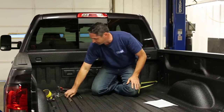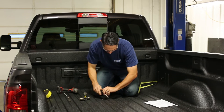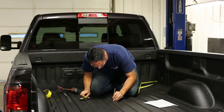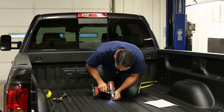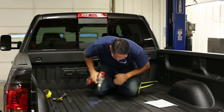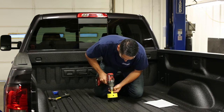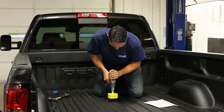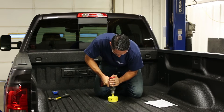Now we can punch our mark with a center punch — make sure you wear your safety glasses. If you can keep this as precise as possible, your hole will be nice and perfect in the middle. Now we can drill our pilot holes. We're going to cut our four-inch hole in the bed — take the time to allow your saw to do the work, don't force it. If you're using a drill like this one, use the slowest speed possible. I like to let the saw go backwards just a little bit to establish a groove, and then we'll actually drill our hole.